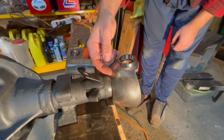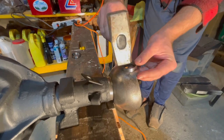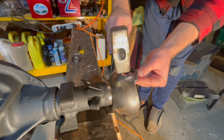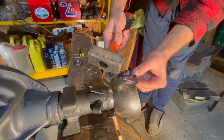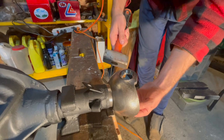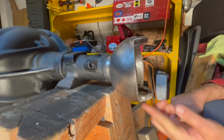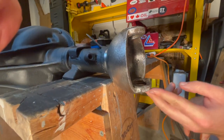The first step is installing the bearing cups into your axle housing — don't overthink it, just get a driver and pound it in. Hammer it in until it seats all the way down and can't go any further, then repeat the same step for the bottom. Now we have both cups seated all the way in.